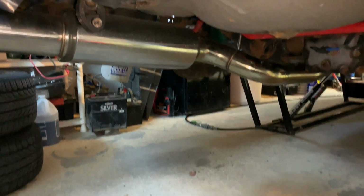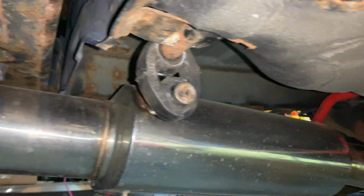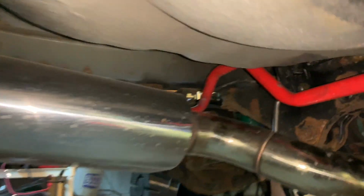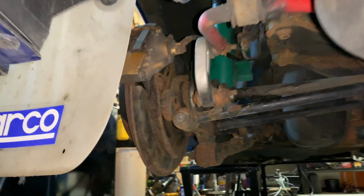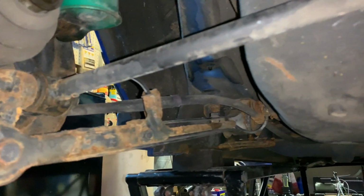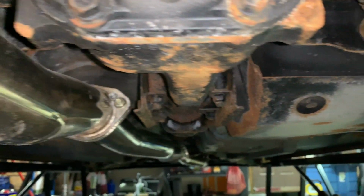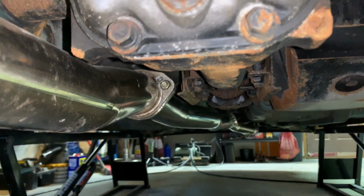Just painting over rust, I don't think is going to do too much, as it will creep through. And we can see here that I think the most I got out of this was a slowed down reaction to the red oxidation, instead of a full covering of it and a full prevention of it. But as you can see, my car was haggard before, and it does not look too bad now, and this is after 3 years, with one little respray last year that I did to cover up some of the sections that I missed.